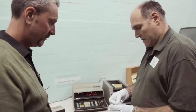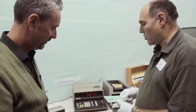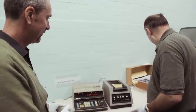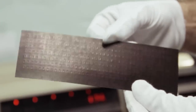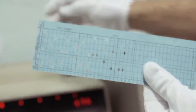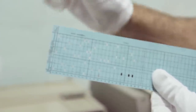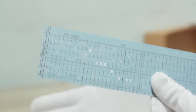It comes on punched cards, which feed into the program card system. The punched cards are able to represent more than you can get to manually on the keyboard. And you put them on these pre-perforated blue cards. You can just see the perforations, and when you punch it out with a pencil or a compass you get holes in it. It uses a photo sensor as it passes through — very much like paper tape of the same era. Interesting that they chose not to use paper tape with this machine, even though those mechanisms were available at the time.